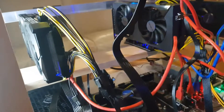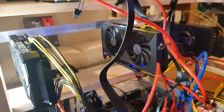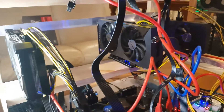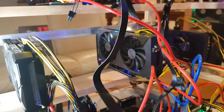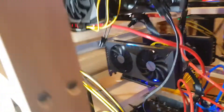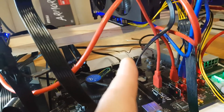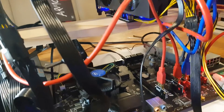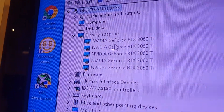Welcome back — good news, we've got five cards on. A tip here: it's not as strict as the 3060 12GB nerf versions where you had to put the 470 driver on and make sure the PCI lane speed was version 3, but when I added the fifth card it booted through the BIOS a few times and didn't register my SSD. All I did was change the PCI lane speed in the BIOS to version 3 and it booted up fine.